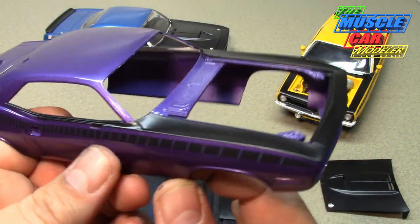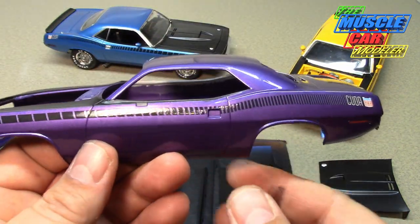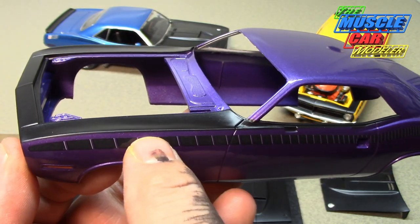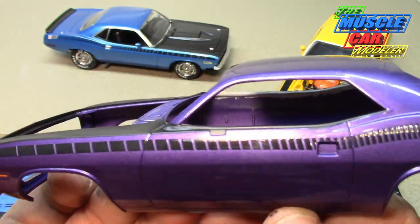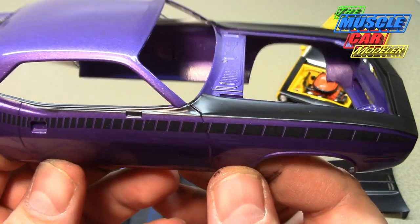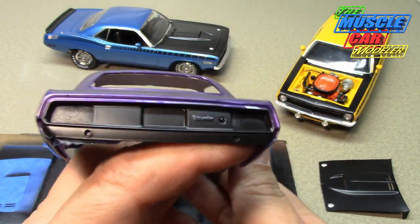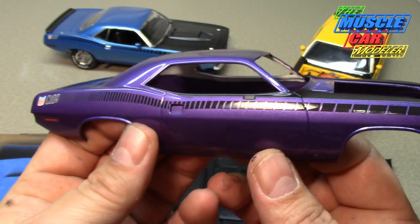I've got a couple of areas where there's just a minor amount of overspray which I'll polish off and polish this line cleaner. You can see a little bit of overspray right there, and where I didn't quite get right to the edge the black is going over, but I'll polish that all off. I'll give this a couple of days to dry. There's a little bit right there too, but that's easy to polish off — then touch up and put the chrome on. I forgot to pull the masking tape out of the tail lights but no biggie.